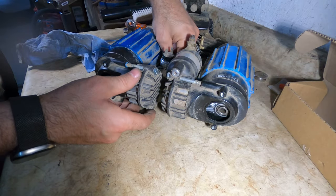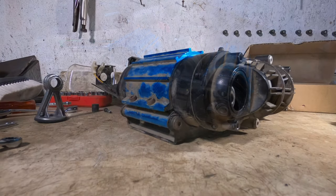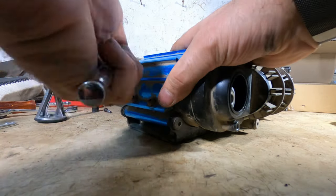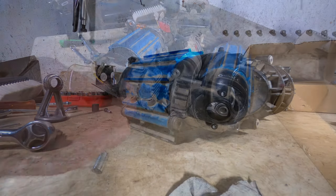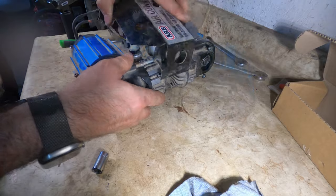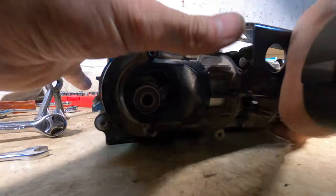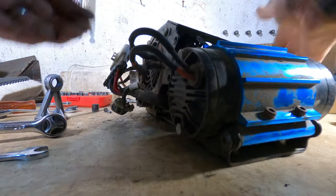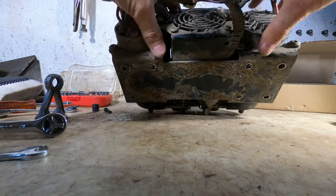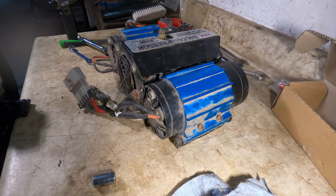And we want the pressure switch towards the top. So I'll tighten up these now because this reassembly has repositioned the compressor within its heat sink. Reconnect the pressure switch. Doesn't really matter which side, it just completes a contact. Big harness goes down to the right spot. There, something like that. And it's just a question of reinstalling these fasteners.